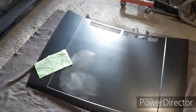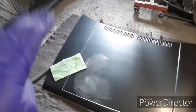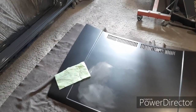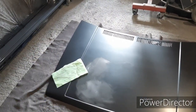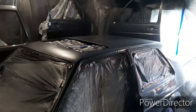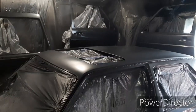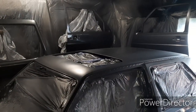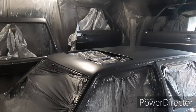The way to get rid of it is just to dust it — literally a dusting from the spray gun, probably a foot to two feet away from the bonnet, just a dusting over it. What happens is if it's a chemical reaction, you're putting too much solvent-heavy paint on it and it reacts with whatever's on the panel. The idea of a dusting coat is that on the roof I've done about 10 dusting coats on the main areas that had bubbled or crinkled up. After about the fifth or sixth dust coat, I gradually increased the amount of paint and got closer to eventually build up a nice thick coat.